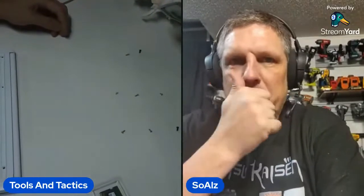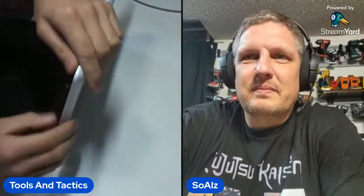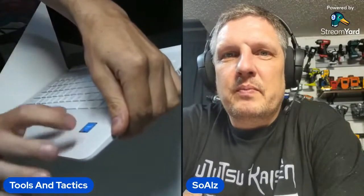Those are the screws right there, in that pattern. We want to just kind of pry this off. I like using my hands — I'm sure you can stick a pry tool in here if you want one. Just carefully go around and figure out what's loose. We're just separating this panel from the body. Close the laptop, face the bottom away from you, and pry with your thumbs in an outward direction, just like that, at this location on the laptop.